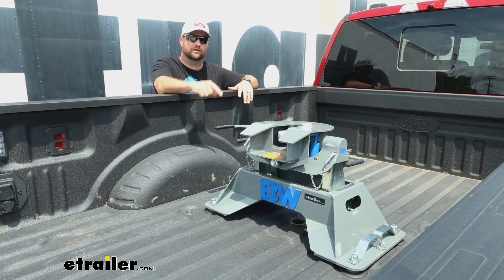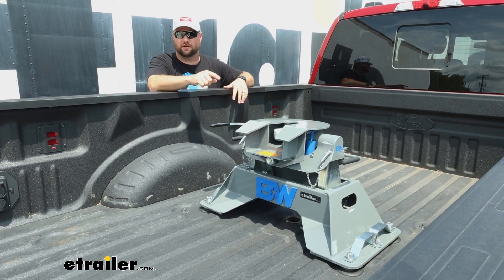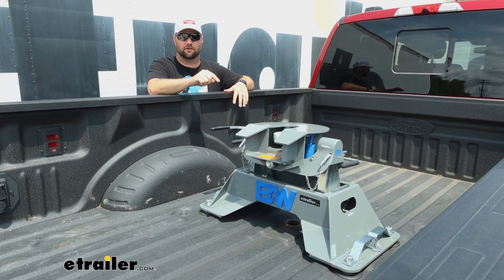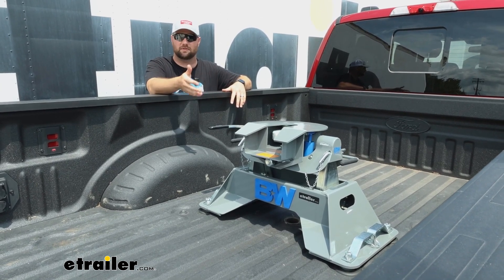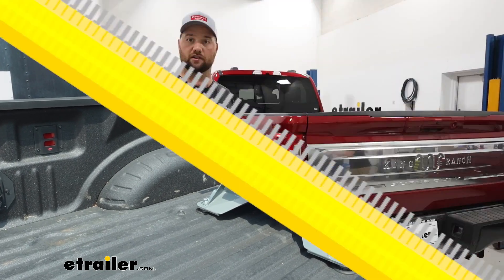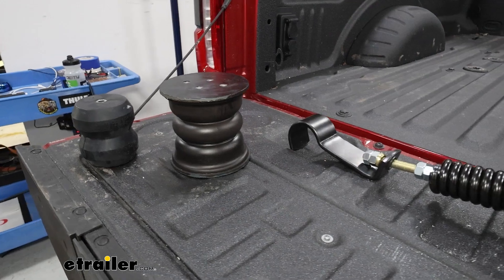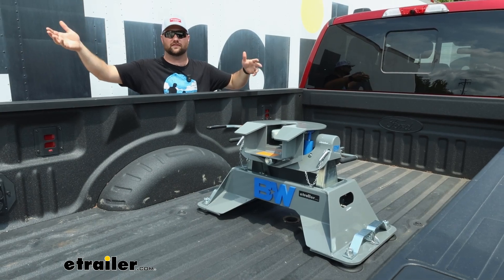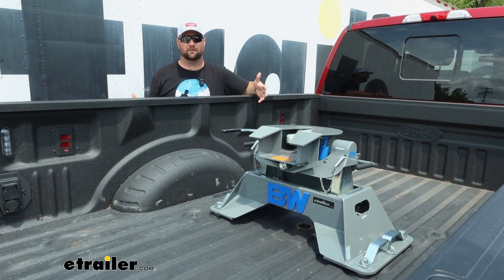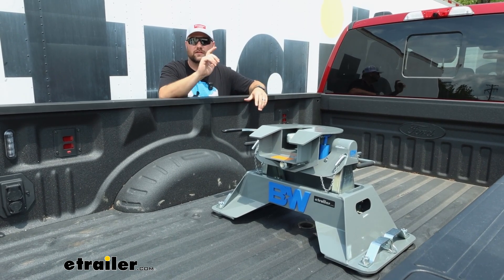The vertical load limit is what's really going to put the strain down on your vehicle suspension. The maximum vertical load limit for the 20,000-pound version of this hitch is 5,000 pounds. If you get the 25,000-pound version, the max vertical load limit is going to be 6,250 pounds. That is a lot of weight pushing down directly over your axle onto your rear suspension. This is where I recommend getting a set of airbags or some sort of rear suspension enhancement to help the back of your truck out. Anytime you're towing a fifth wheel, unless you're towing a super light one — say a 6,000-pound fifth wheel with an F-350 — it's not going to hardly touch the rear suspension. But if you're already having issues with your truck squatting, I highly recommend taking a look at our website and videos to see what options are best for you.